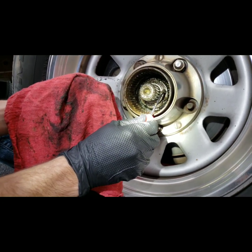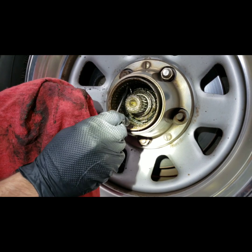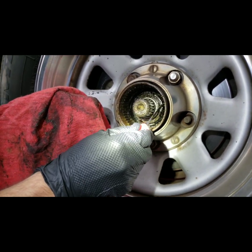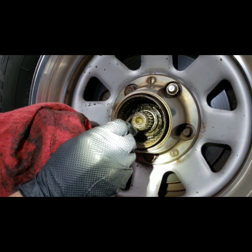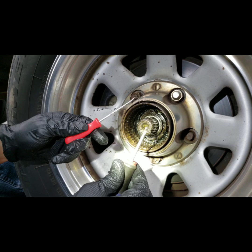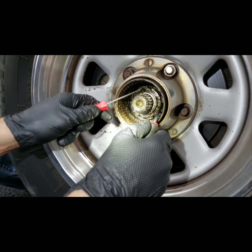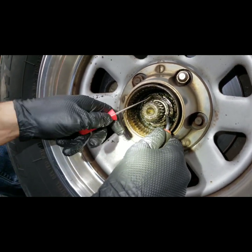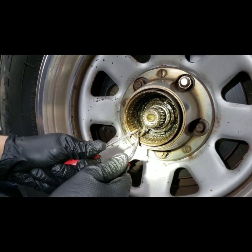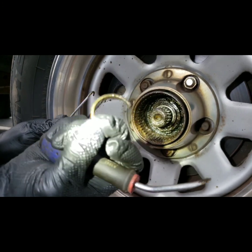Next step: there's a C-ring in here — it's about half a circle, a pretty wide C-ring. It's right behind the splines in a little groove. You've got to get that C-ring out. The best way is to apply quite a bit of force with a pick or a flathead screwdriver — you need about two items here. Push down on either end of that C-ring and it should fall to the bottom. There it is — the C-ring is out.